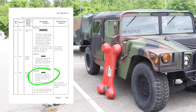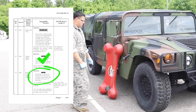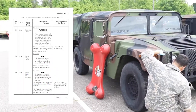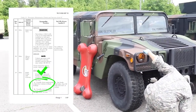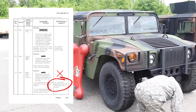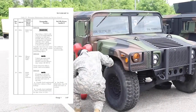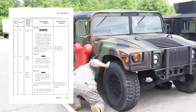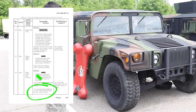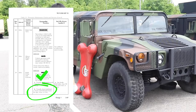Check right front side exterior. Note: if leakage is detected, further investigation is needed to determine the location and cause of the leak. Visually check underneath the vehicle for evidence of fluid leakage. Vehicle is not mission capable if there are any brake fluid leaks, Class III leaks of oil, fuel, or coolant. Visually check half shaft, CV boots, and ball joint boots for rips, tears, or cuts.